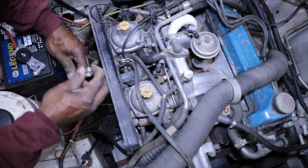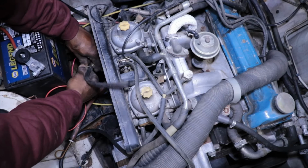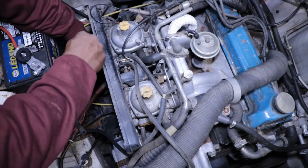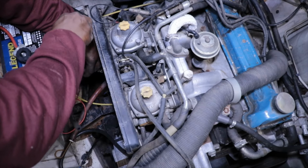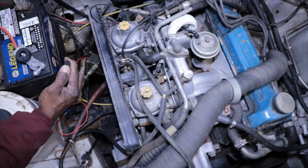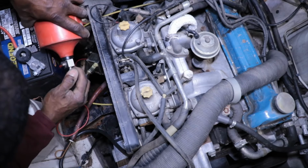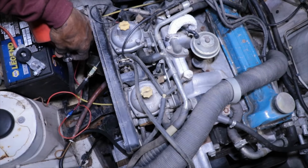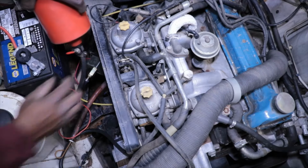So I got the brake freed up on the back. I don't think it was the emergency brake, the lever that goes into the passenger side wheel got frozen when I pulled the emergency brake unloading it off the trailer. So I kept spraying some PB Blaster in there, and it freed up a little bit, but if I pull the emergency brake, it might lock up again on that side. So hopefully, if the brake's working, we can drive it. That'll free up some more.